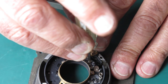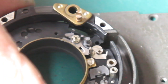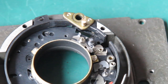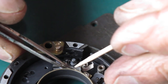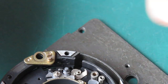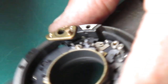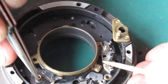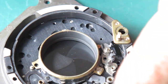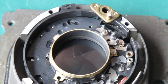I can do that screw up. The tail of that spring has to be lifted up and over and against the lens tube, so it bears on this lever here. If I hold back the B lever, I can move back my blade actuating ring and the blades are closed. There's a bit of graphite powder sitting there — we'll blow that away.